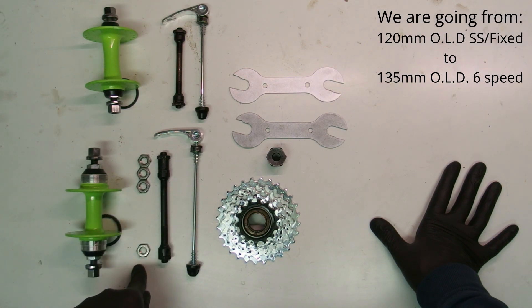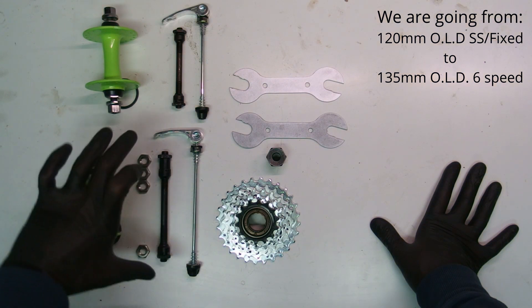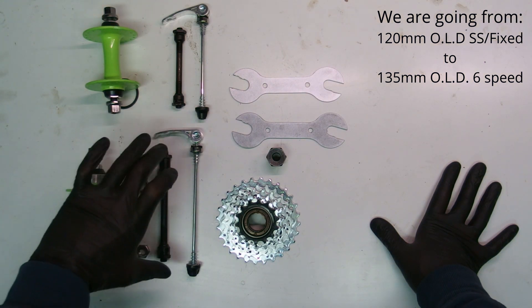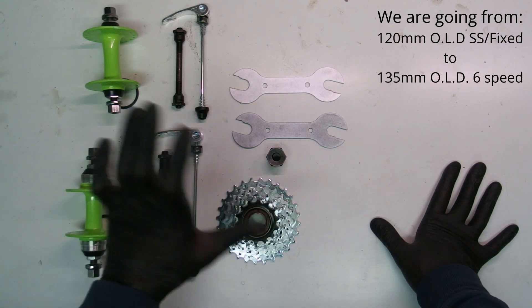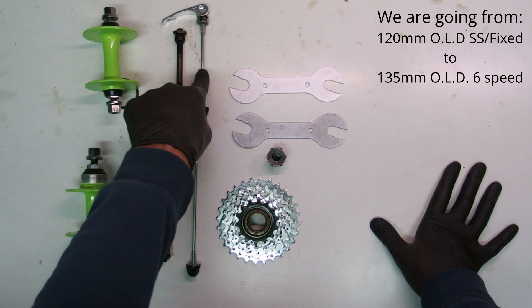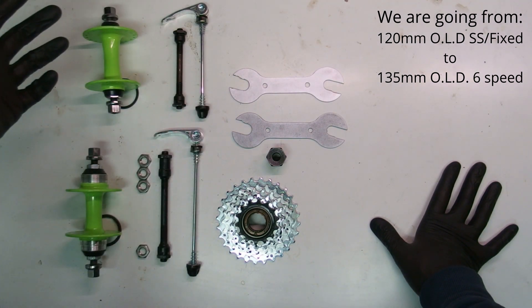In order to provide proper spacing of the entire assembly, I also intend to put this nut on this side of the axle, because that's going to give me the proper 135 millimeter dropout space for the entire hub. And with that, I intend to put this axle — which is compatible with this quick release — inside this hub, because that's my entire conversion.